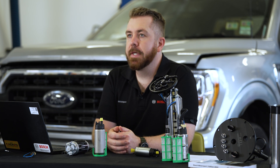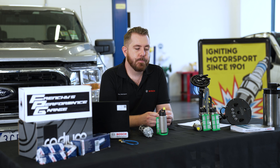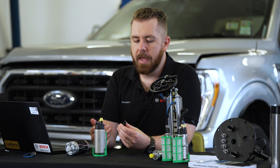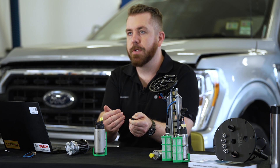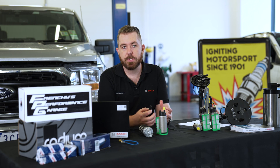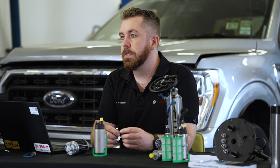A pump's fuel supply is a relationship with two different factors. First, you have fuel pressure, which we measure in psi or kPa, and secondly you have your fuel volume flow, which is often measured in gallons per hour or litres per hour. To understand this concept it's easy to think of your garden hose in the backyard. You turn the tap on full blast and what you initially have at the end of the hose is a high volume flow but with low pressure. Now if you introduce a restriction by pinching the end of that hose, you'll actually reduce the flow but increase the pressure. The same principle applies in your fuel system. There are various restrictive elements that determine the fuel pressure — of course there's the fuel pressure regulator, but also other factors such as filters, fuel line diameter, return on the fuel system, and so on.